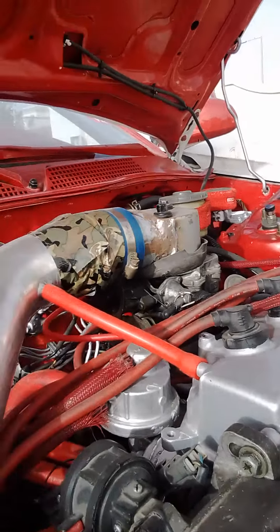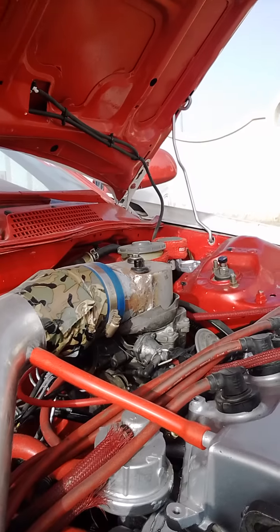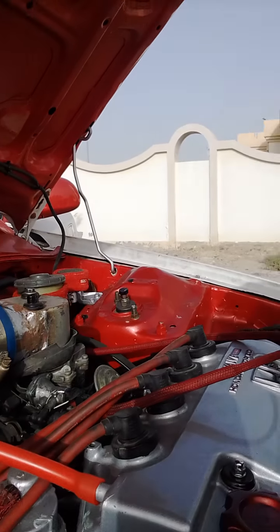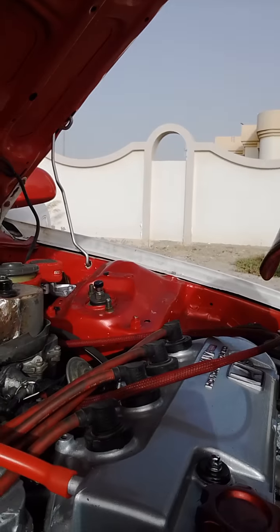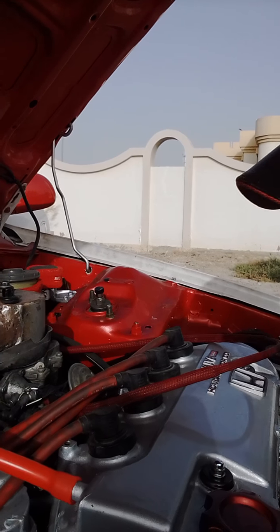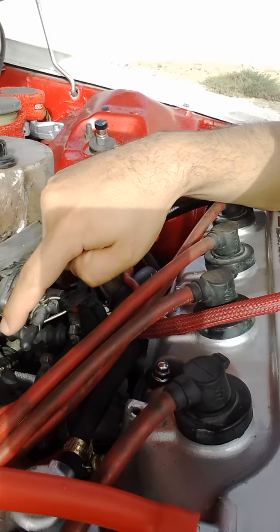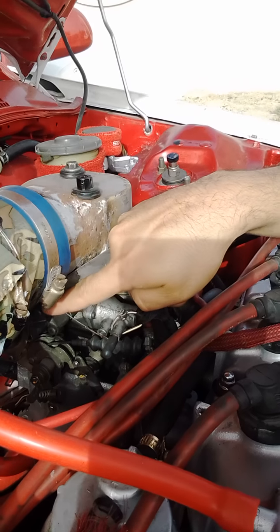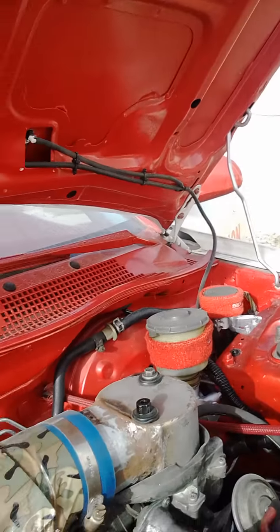The electric choke on all of those carburetor models, there are a lot of different models, they basically don't work. So what you need to do is keep the valve of the electric choke open. Otherwise, your carburetor is going to misfire or misburn or won't allow air to go in. I'm not sure if you can see my finger here. I have pulled the valve here to keep the valve open. Anyways, and then I've done a DVAC project.